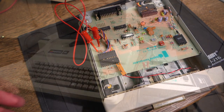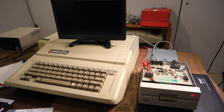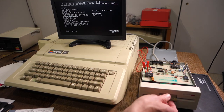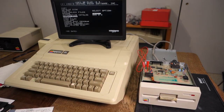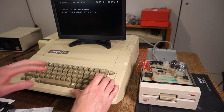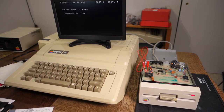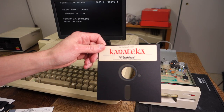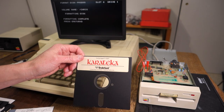So let's give it a try. I'm going to boot up a copy of Copy II Plus here with a non-write-protected disk. Now that we have our jumper wire in place, I'm going to go ahead and format the disk. I'll take the disk out and flip it over — this side here is not notched, so normally we wouldn't be able to format this and it would just give us an error. However, now we can just say format ProDOS, confirm we're ready to format, and give it a name. You can just tell by the sound that it is successfully formatting that drive. We were able to successfully write that disk. If you had a copy of Karateka that was corrupt for some reason, you could use this trick to make a new copy without having to punch any holes in the disk itself.